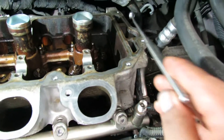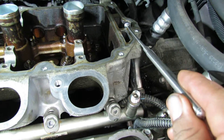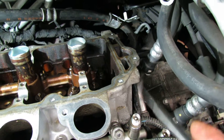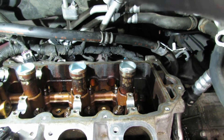After that, you switch to the 13mm bolt right here. They want you to go 11 foot-pounds, and then after that switch it to 75 degrees. Then you torque it to 75 degrees, and you're done torquing the Bank 1 cylinder head properly.